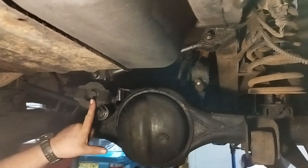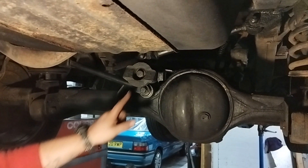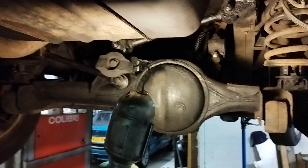Down here is the Watts link. The way you check this is with the car on the floor — get on the steps or hang off it somewhere and rock it left and right. If you can hear a knock, it's your Watts link. Pretty expensive to fix — a couple of hundred quid if someone does it for you.